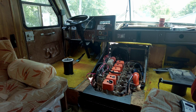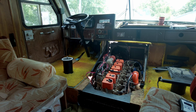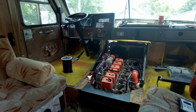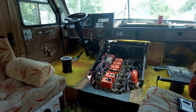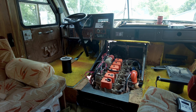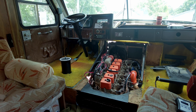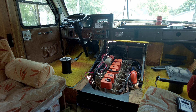Right now the fuel system is 100% operational and perfect from tank to engine — that makes me happy. I also discovered that the float was corroded and wasn't working either. It wasn't electrically solid and wasn't sending the right signal to my gauge package, so that's fixed too.